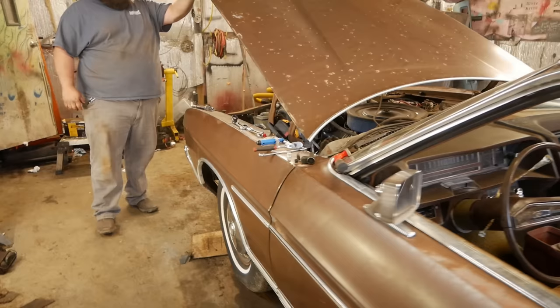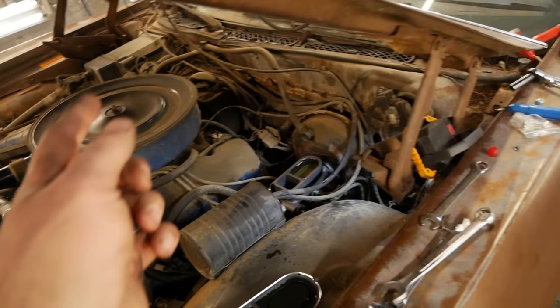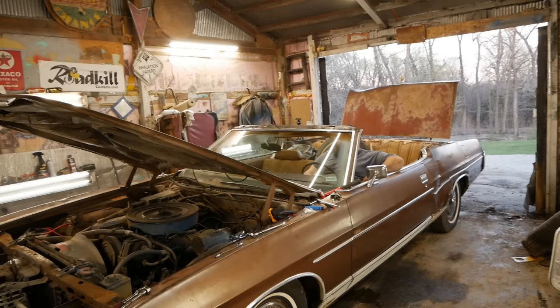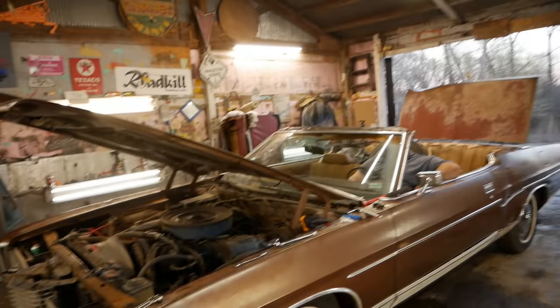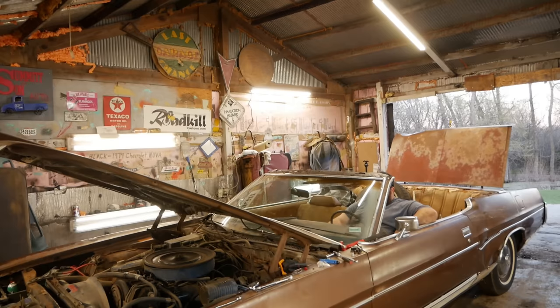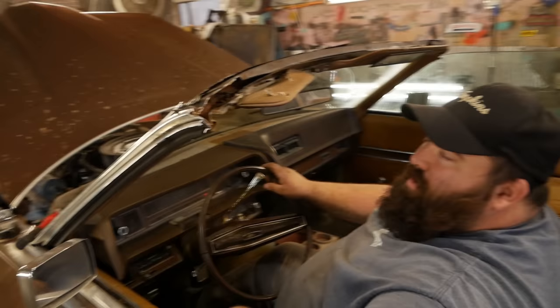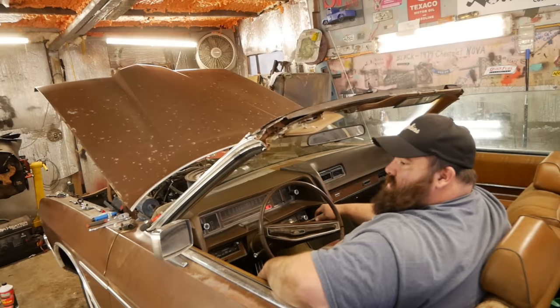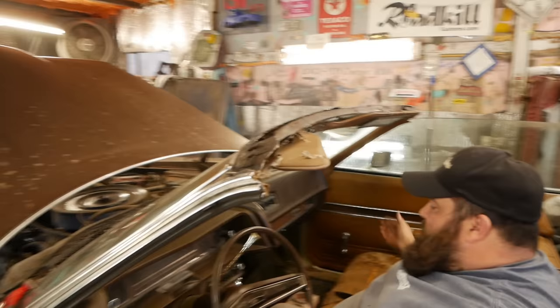It was a giant air bubble in the master cylinder. I just popped off the line, put my thumb on it, hit the brakes a couple times — I guess we just didn't get it bench bled all the way. It actually feels decent. It's absolutely working now. They don't return well, they don't feel that great, but they do function. The problem before with the bad master cylinder was it faded because of the loss of pressure. It feels good. That's done. Fixed. Not really, but enough.